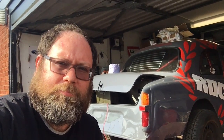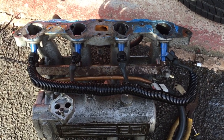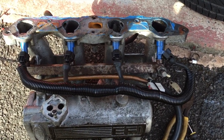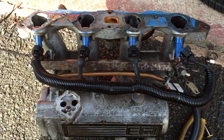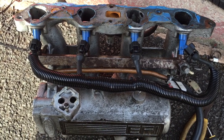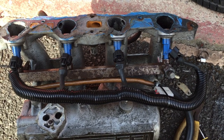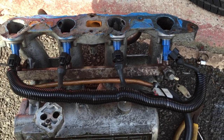Because I really don't want to start on those bulkhead connectors yet, I thought I'd find some other little bits and pieces to do with the wiring. One of those jobs is tidying up the injector subloom. I did that on the old EFI inlet to help me get the spacing right, and this is what I've come up with — a little plug hidden away under there to go into the main loom, and then each of the injector leads just tucking out nicely like that. So it's the same old loom as it was before, just tidied up. This was really nice and reliable, just looked a mess — so happy days.